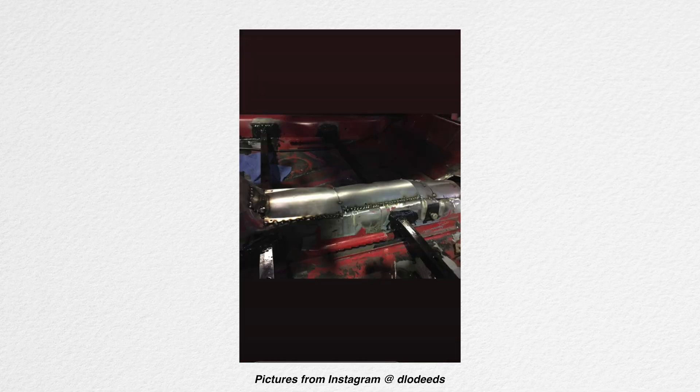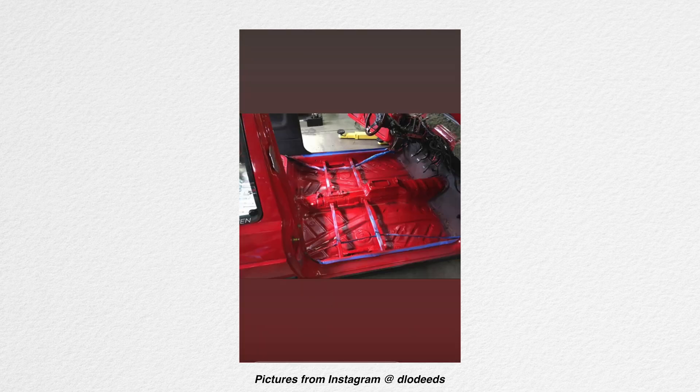I need to conclude when I'm home because I need to look at some photos — actually, I found the photos and the build I was referring to. It's some guy from the US who made his Mark II all-wheel drive, and the same will apply. As you can see from the picture, behind the gearbox toward the passenger seat in the back is where you need to cut out and make the tunnel a bit higher in order to go all-wheel drive. I found this build on Instagram many years ago. I haven't done this build myself, but I hope this information will help you along. Good luck!